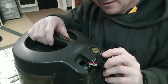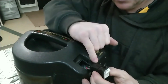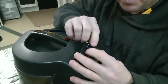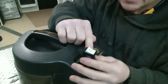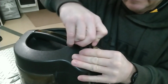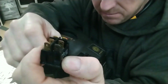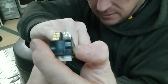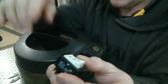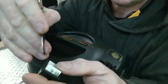I'm inspecting the wire and I don't see any damage. And you want to look on your switch and make sure you don't have a release tab. If not, you'll pull the blades right out of the switch and possibly damage the quick connect. I don't see any. I'm going to go ahead and wiggle it and pull that out. Looking for blades that are burnt and discolored. I don't see any. Now I am curious what happened to this switch.